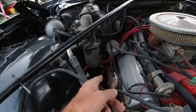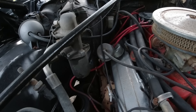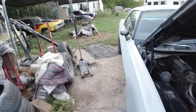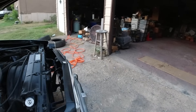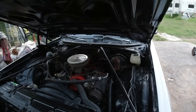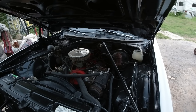There's an exhaust leak down here — it's probably this heat flapper thing or a donut gasket. Other than that, the exhaust is new from about here back — new pipe, new muffler, new tailpipe. But when you do dual exhaust you have to pretty much do away with that. I should have ordered it later, but I did order some one-chamber race mufflers and a pipe kit, though it's probably not going to be here for this video.